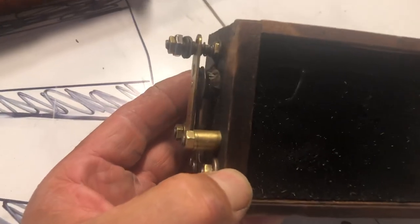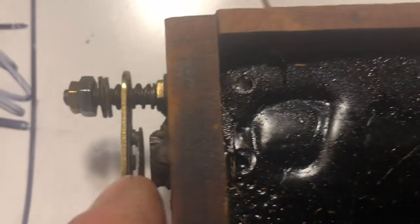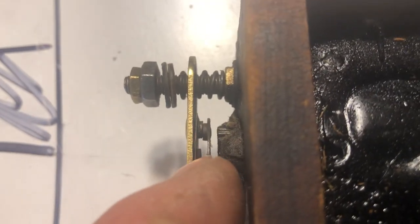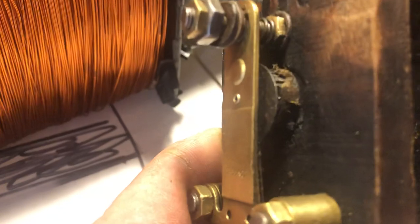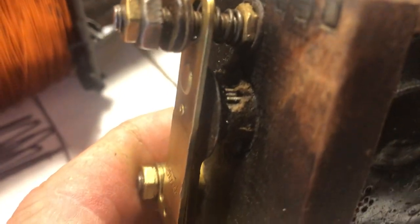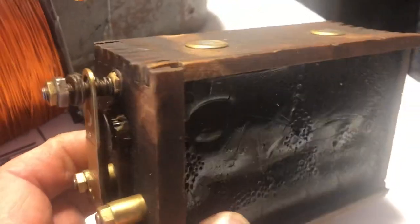That's tar, by the way. And you create an oscillation back and forth, and you can see how this right up front there, see that right there, that's a point. And the core, look at that core, is little rods. Look at them all. They're like little welding rods tied. So there is your laminate core in the inside of this, wound with real thin wire, thinner than that, to bring the voltage up.